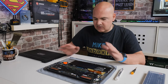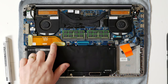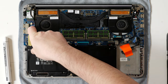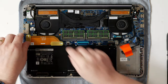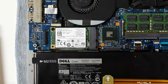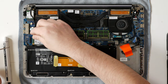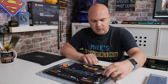To gain access to the mSATA drive, it's not completely apparent where it is — it is actually hidden. Underneath this ribbon connector is the mSATA drive. We've got these two tabs that say pull, so just put your finger slightly under it and lever up slightly and it will pop out — same on the other side. Taking away this ribbon then reveals the mSATA drive. These are normally held in with two crosshead PH00 screws. Take out your screw or both if you've got both installed. The drive will pop up like most m.2-style drives do, and then you can remove the drive.